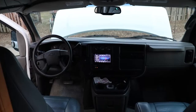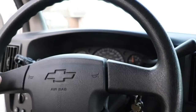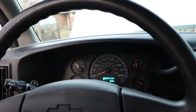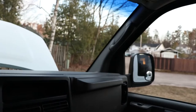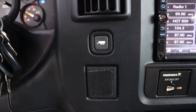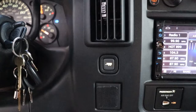Now let's pop up into the front of the vehicle and familiarize ourselves with how it works. Check your horn — you may not use it very often so give it a shot before you go. Check your flashers, brake lights, and running lights. Check your dash lights and your defrost — make sure that works. This vehicle doesn't have heated mirrors, so depending on the time of year they can get foggy. The tow haul mode on the older vehicles is a bit dangerous — you might think that putting it in tow haul in the mountains will help you going downhill, but it does not have descent control on this vehicle, so it will run away.